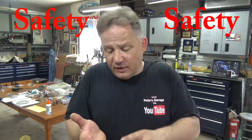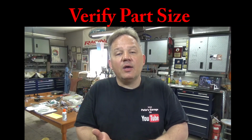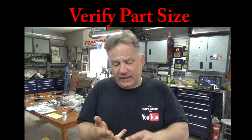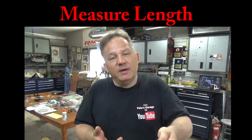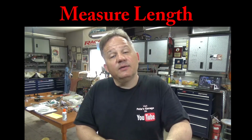So, I hope you enjoyed that. Remember those tips. Now, I guess I should go over the tips, right? First tip, anytime you're working on your car, safety first. Make sure you're supporting the vehicle. Before you take the part out of the bag, hold it up, make sure it's the same size, especially on tie rods because they do come in different lengths. When you take it off, use the jam nut as a reference. Measure with a ruler and make sure you get the center in the same spot. When you put it back on, you can recheck.